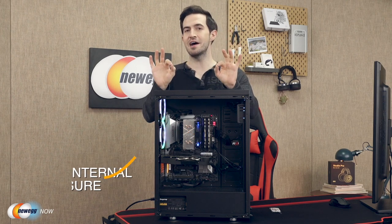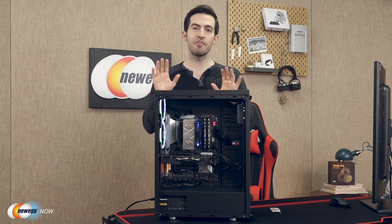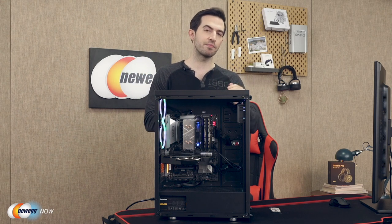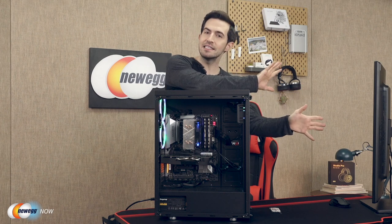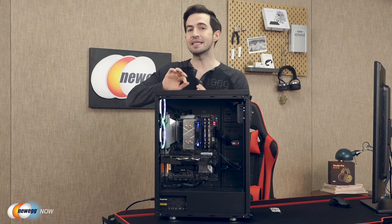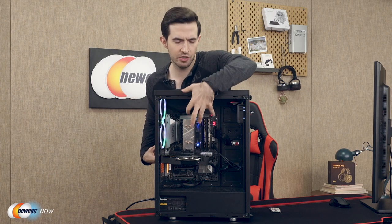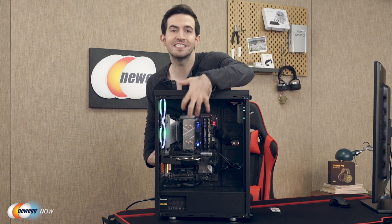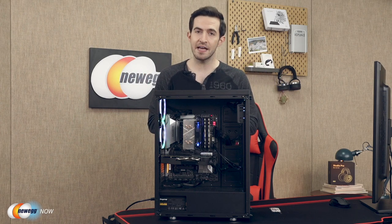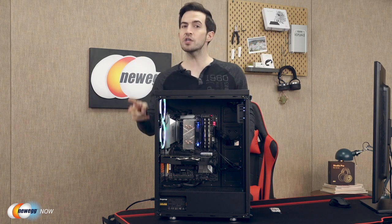Imagine if we only had the exhaust fans — that would mean placing all your fans at the rear panel. While this is effective, it might result in more dust being pulled into your case over time because air is drawn in where there isn't a filter. There's positive internal air pressure, meaning more air is blown into the case than out. This is good, but not if taken to the extreme — too much air blown in might result in not enough airflow inside and hot air getting trapped. The extreme would be like taking a leaf blower and blowing it into your computer, which is why what we want is slightly positive internal air pressure.